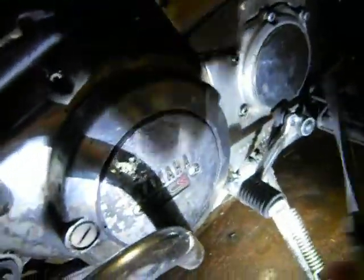When you do an oil change, you're supposed to pull that and drain it so it gets fresh lube too. A lot of people don't when they do an oil swap. That bottom screw, hidden behind the shift lever, also has a copper crush washer on the backside of it. That copper crush washer has caused a lot of people oil leak issues — it'll seep oil if you don't replace that crush washer after you drain the oil.